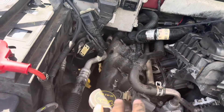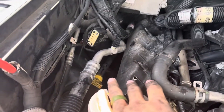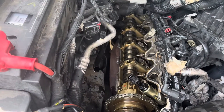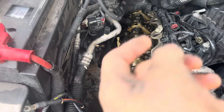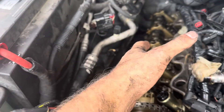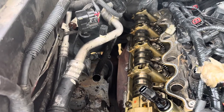You're going to want to take out all the electrical stuff and move all the connectors out of the way. I used a bungee cord on the PCM main harness and moved it to the side — it's very tight for this valve cover. The accumulator lines are in the way, the transmission dipstick is in the way, so do your best to open this up. I took the coil packs out and lined them up in order — don't get any dirt in the tips. There are 8mm bolts that go all the way around. The valve cover was a struggle to get off even with all the bolts loose. I had to take off a coolant line — I stuffed a paper towel in there, not much came out. We finally got it out by tilting it up towards me to clear the accumulator line, then rocking it back and forth.